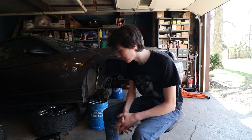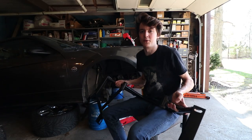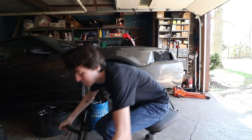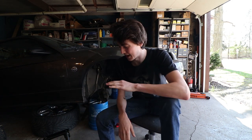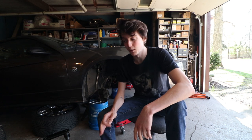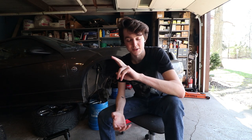If you've made it to the end of the video, that either means you didn't get mad and you stuck with it — I really hope this video helped you guys. Thank you so much for watching. Now with my old K-member out, I can install this tubular K-member. The benefit of a tubular K-member over the stock one is that the stock one weighs a ton, and the tubular one is going to save me about 50 to 70 pounds just on the K-member alone — and that's not including any of the other suspension parts I'm replacing. Comment down below if this helped you out or what you'd like to see next. Thank you guys for watching — peace out, I'll see you in the next one.